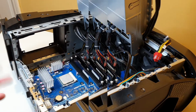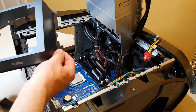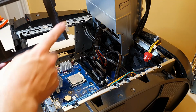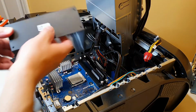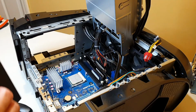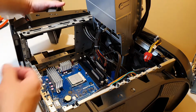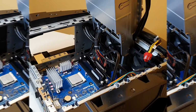So I removed the top radiator shroud, and it was fairly easy. Just need to remove 2 screws, one there and one on the back, and you just pull that out like you did with the AIO. This frees up a lot of space on the top, so the radiator now fits perfectly. It's just a matter to find a way to screw it in like the original.